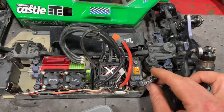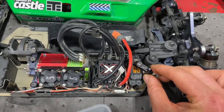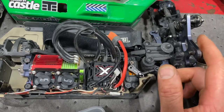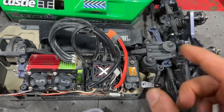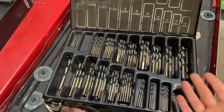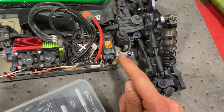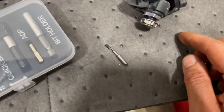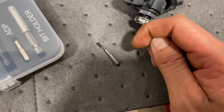The screw came loose for my servo horn here. When I went to take it off, the screw ended up stripping out the end because I didn't have my good bits with me at the track. So today I brought it into work where I have all the drill bits, and drilled out the head of the bolt so I could just pull it off. That left me with just the bottom of the bolt — a very little tiny threaded part.